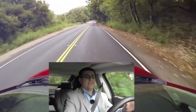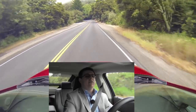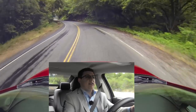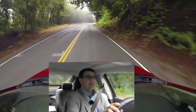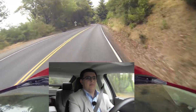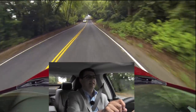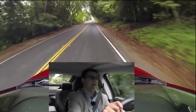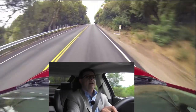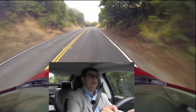If your car is operating like a Toyota Prius or a Ford C-Max Energy Hybrid, where the engine and the electric motor are both motivating the vehicle, that's when you get your best 0-60 time. If it's operating in EV-only mode, then you get about 8.8 seconds — it's a little bit slower because there's not quite as high of a torque advantage with that motor alone. When the Volt is in pure EV mode, acceleration feels just like a Nissan Leaf or any other EV. You get this swell of acceleration from the electric motor, lots of low-end torque, and the acceleration is very smooth all the way up to about 100 miles an hour.